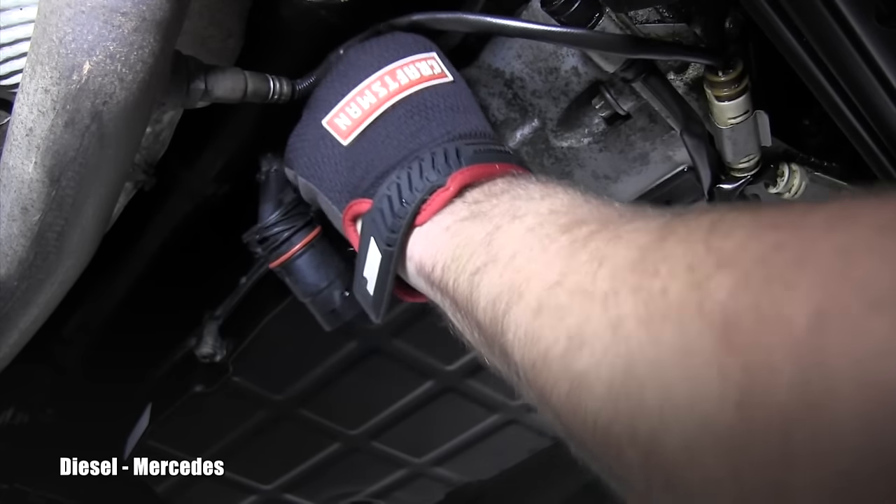The measurements will be taken with the engine running. Right now the engine and transmission fluid are cold, so I will use the cold range right here — I need to get that fluid between these two marks. That will tell me I can go for the test drive and fully warm up the transmission. After the test drive it definitely needs to be at 80 degrees Celsius, between those two lines, with the engine running.